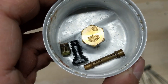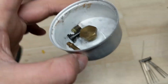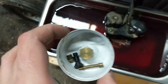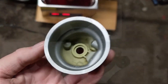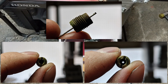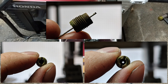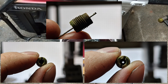I have the bowl bolt, the pilot jet, the main jet, and also the distribution tube here in another little Tecumseh snowblower carburetor bowl that I'm going to dump in. I also have the bowl to the carburetor here — you guys can see there's quite a bit of debris at the bottom. I'll put up on screen a picture of what the main jet looked like: on the left it's clogged, in the center I just used an oxy-acetylene tip cleaner to poke through that gunk — that's just broken down fuel — and on the right you can see it's wide open. That's the difference between your engine not getting any fuel and your engine now getting fuel.